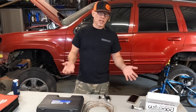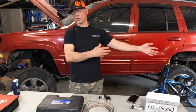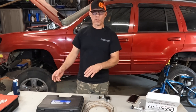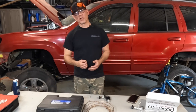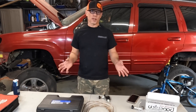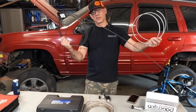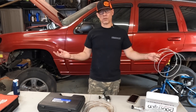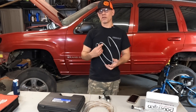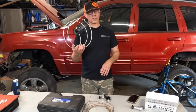If you've ever had to replace or make brake lines for a vehicle, it can be a pretty miserable process — cutting out the old lines isn't bad, but then you've got to feed in new line, bend and shape and form everything to the bottom of the vehicle. Throughout the years we've always used some form of steel line, and of course that's been the standard. Steel also rots out. A lot of you watching this that don't live where I live don't even know what I'm talking about. Brake lines rot out in wet, humid climates, but in the rust belt here in the Midwest where we use salt, these things go to crap bad.